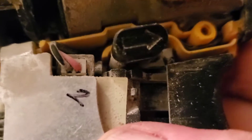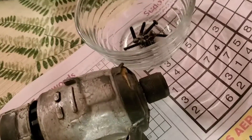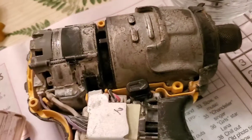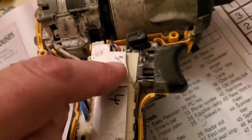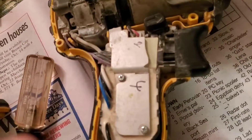The switch here is just a little piece of plastic with a hole in the middle. Watch that little tab underneath — hear it clicking? That little lever on top of the switch moves back and forth as you push this lever back and forth. Since that's moving okay, and that's part of the main switch and speed control assembly, that means we're most likely almost certainly going to have to replace this whole switch assembly.